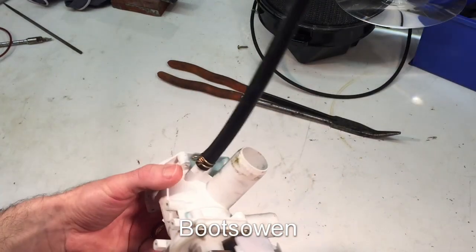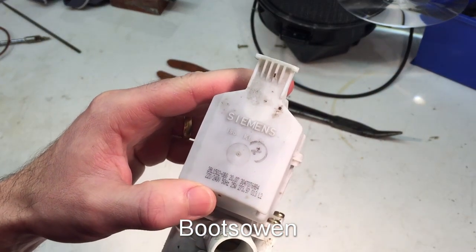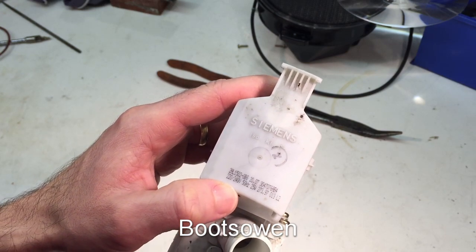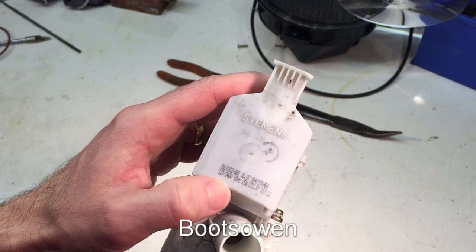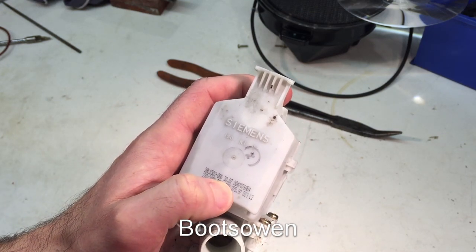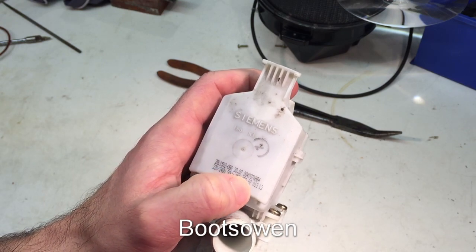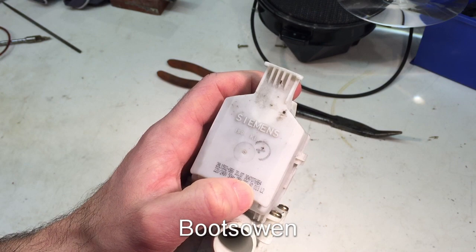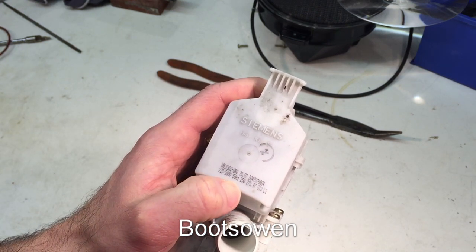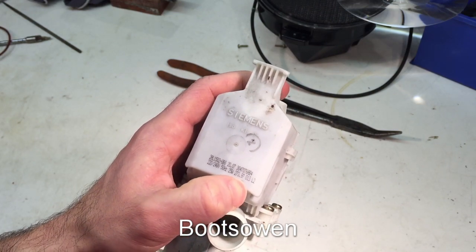This is a Siemens pump — it's the one that came off the Bosch. If we get some numbers there, it's a Siemens. There are loads of little numbers there: 2AL1502-OBG 20.07, so I presume that's week 20 of 2007. Another number: 3047076AB4, 220-240V, 50Hz, 25W, 273.97013L2.